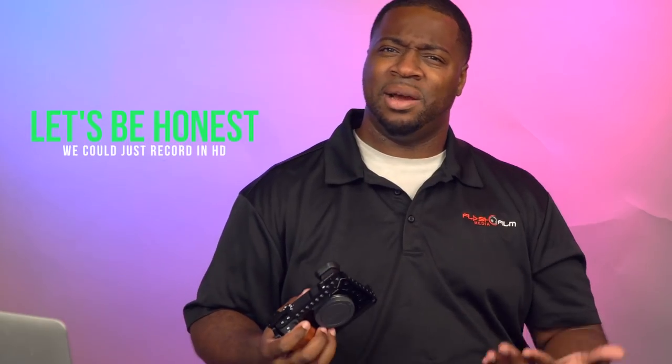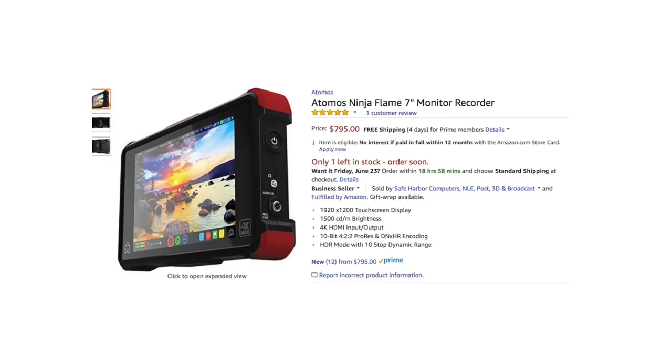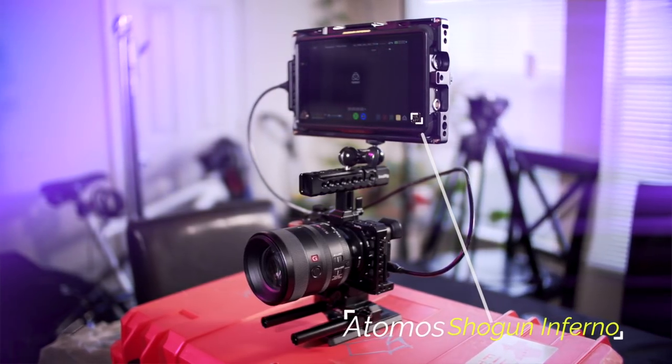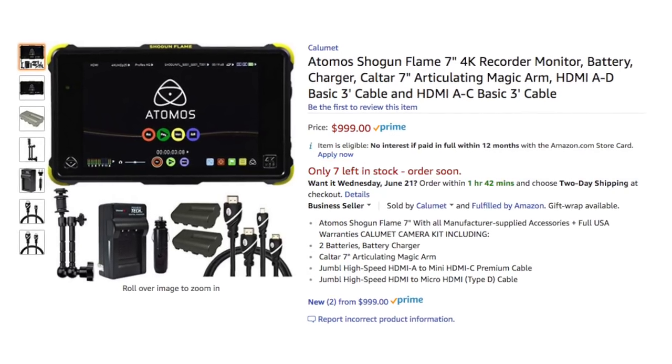Now let's go back to the recorder part and why that's important. We were in the process of looking for multiple cameras to record a conference. We like the picture and low light capabilities of the A6500, but it doesn't record 4K that long. Overcoming that would prevent us from buying new cameras — another Sony 4K camera is at least $2,000. But you can get an Atomos recorder for $795. Not only do you get Atomos HDR, which is great when shooting with S-Log, but for $999 the Shogun Flame gives you SDI ports. You can run it from the recorder to a Blackmagic production switcher and record all day long.